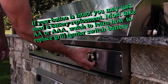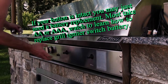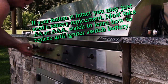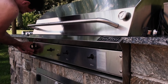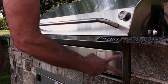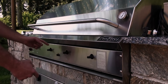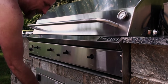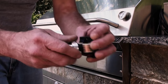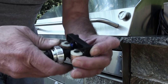We're gonna take the knobs off by just pulling them straight out. On this particular one we have four screws we have to take out. This whole panel will come out and we'll be able to get to the back of the clicker button — just gonna reach up underneath the panel, unscrew the trim of the clicker, swap the wires out, and put the button back on.